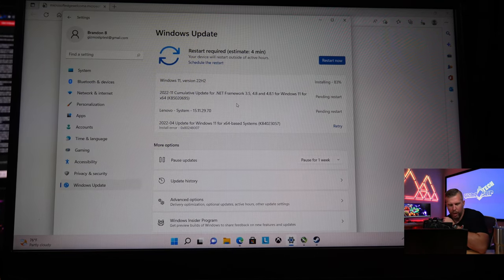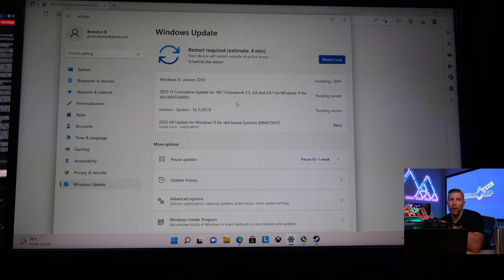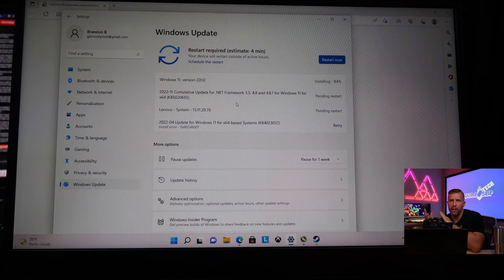Lego Bob Bricks, number one thing I would do is make sure all your drivers are up to date. Because sometimes if you have outdated firmware or drivers on your machine, maybe it's not power limiting your laptop GPU how it should be power limited. Because usually laptop GPUs will start to throttle at like 85 or 87 degrees. That said, it just depends.